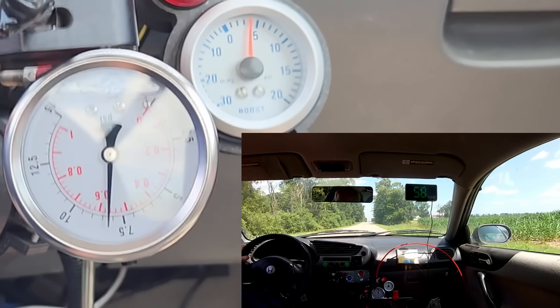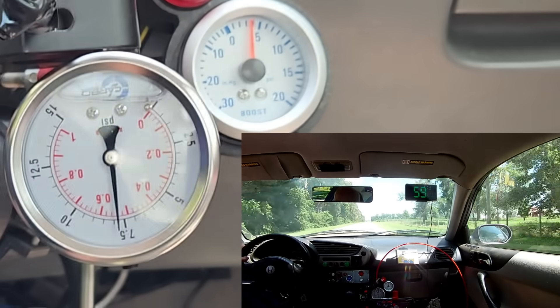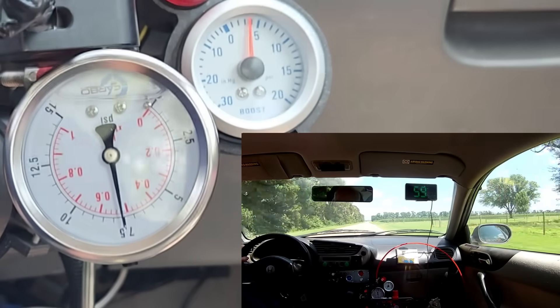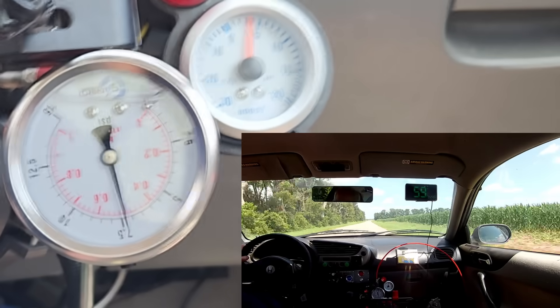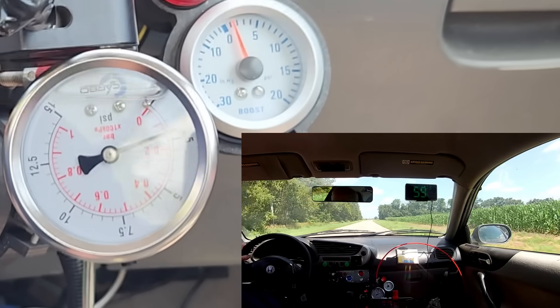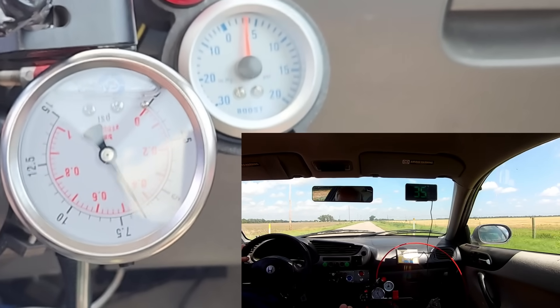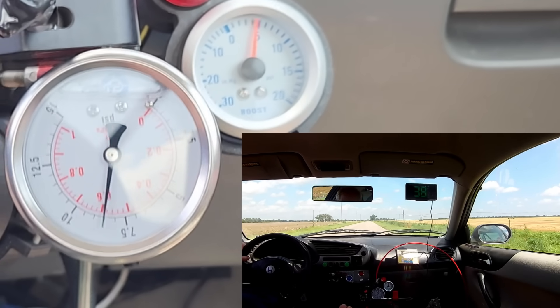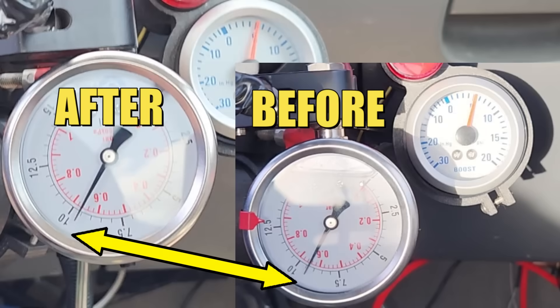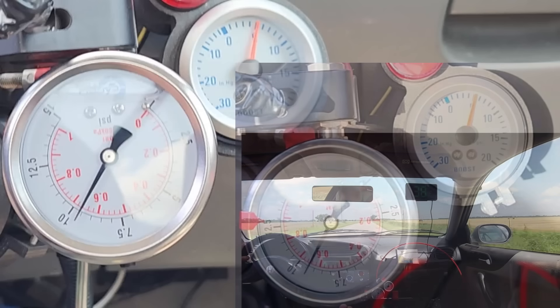At first glance, the boost appears exactly the same despite having slightly more back pressure — that's something that we can all see. But from the driver's perspective, this car actually feels faster. What I mean by that is the car keeps going faster, and it's hard to keep a constant load on the engine. Very interesting. So if we look at this snapshot from before, we can see a slight difference in back pressure, but we have the same amount of boost. It's hard to say what's going on — the numbers say we're going in the wrong direction, but the car seems faster.